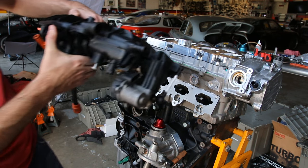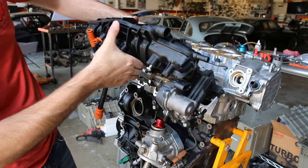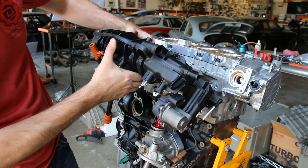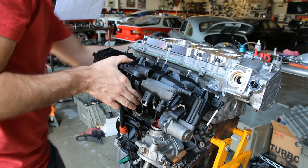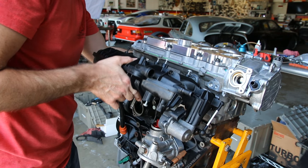As we install our manifold in place — again, the injectors are already in place — we get the lower mounting studs in place and then get all this slid into the engine.